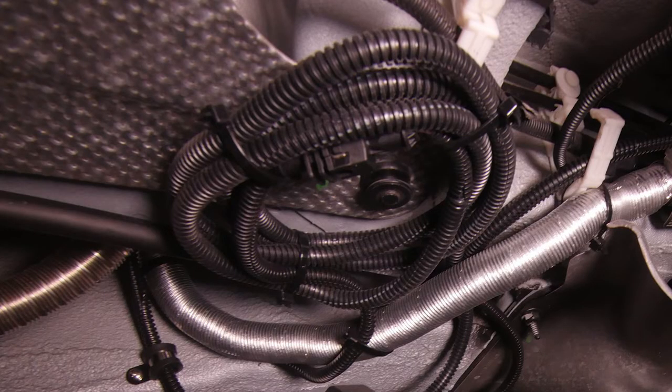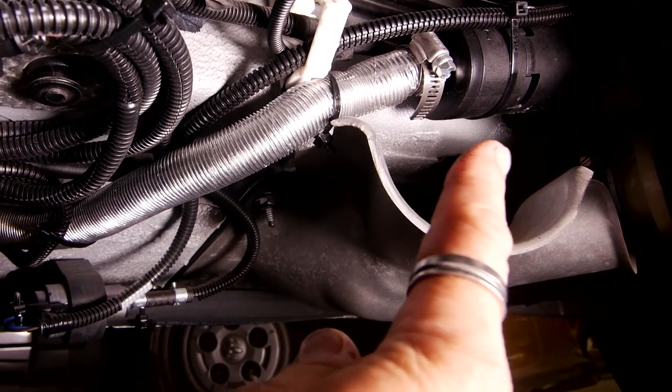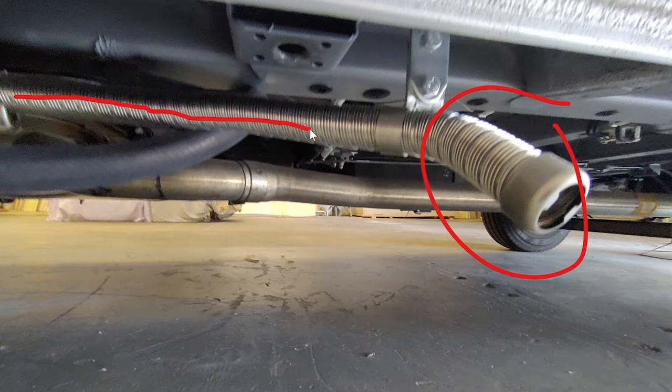A few tips on routing under the van: for the combustion air intake, make sure to locate it far away from the combustion exhaust so you're not sucking any exhaust air into your intake. Try to protect it from splashing water or debris — in this install it's semi-protected by the shield around the vehicle gas tank fill. For the combustion exhaust, be aware that this gets very hot, so route it away from other things. The hose should extend past the sidewall of the van so exhaust gases don't pool underneath. It should slope down over its entire route, even if only slightly, so any condensation can drain out. If you have any low points, you can drill a quarter-inch hole at the bottom of those.